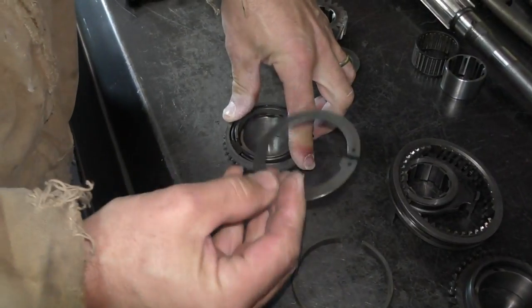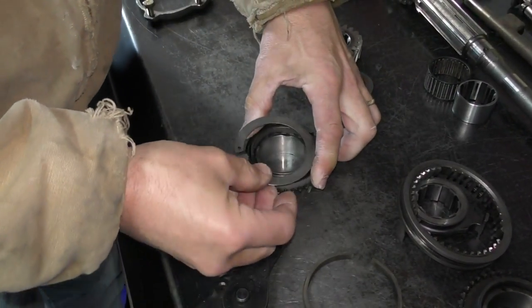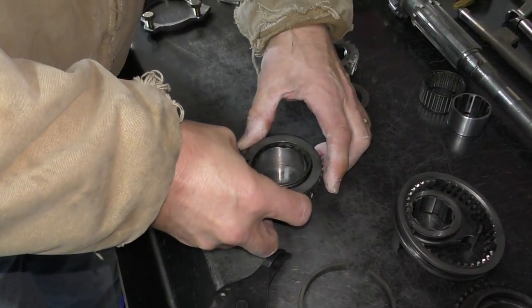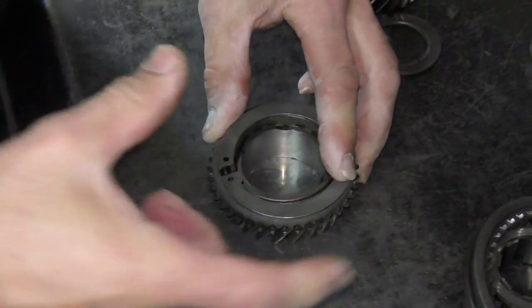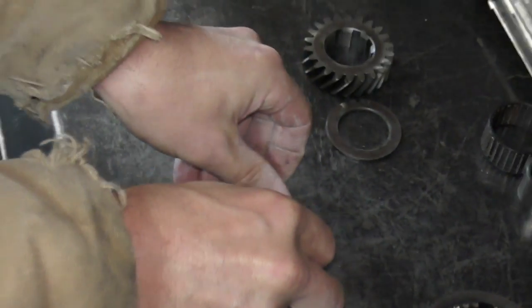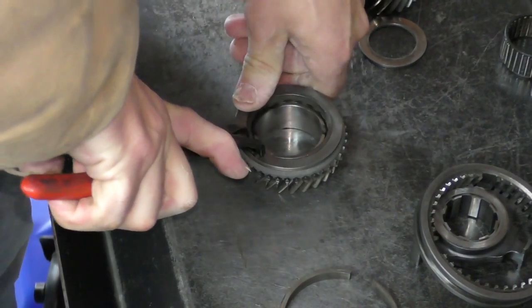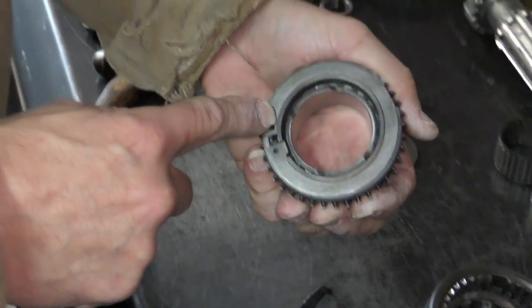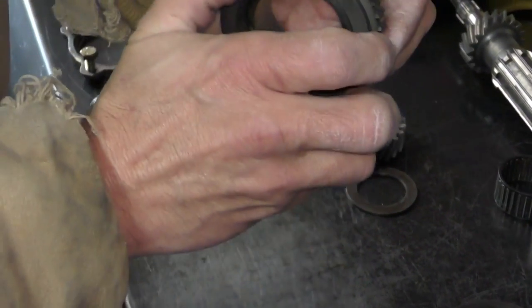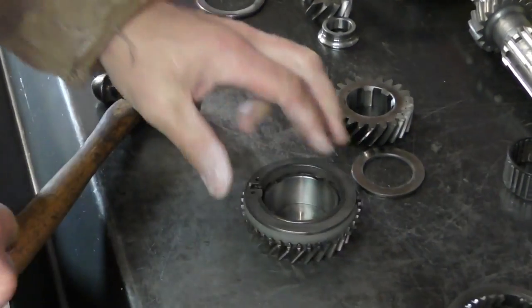As I'm putting my circlip on I'll tend to hold it in place. When I install these the circlips can go in either way, and typically if they've got some wear on one side I'll flip them over. What I normally do is put it in and twist it to engage that groove — that helps hold the synchro ring down while I walk it around and install it. These can be a little bit of a battle. I worked it around in one direction, used my little hammer to tap down the last part, and once it's in I want to make sure the synchro band turns with a fair amount of pressure on it. That's the first one done.